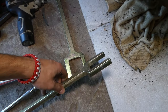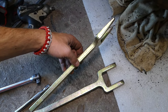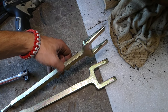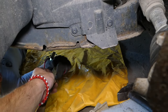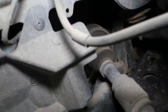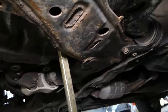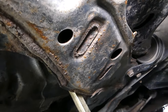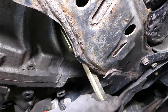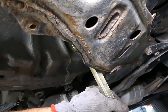So what we'll be using now, guys, these tools, you can find them listed in the description of the video below. This is an axle popper tool. The one that will fit in our case will be this one. It will go between the transmission side and the CV axle. Let me show you now. It's going to go right there, between the two, and then just pry on it. We might need to just tap on it a little bit.